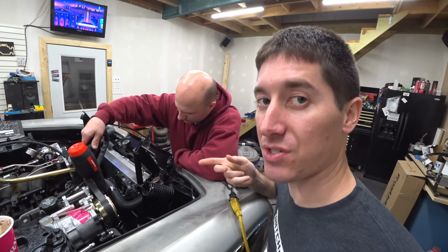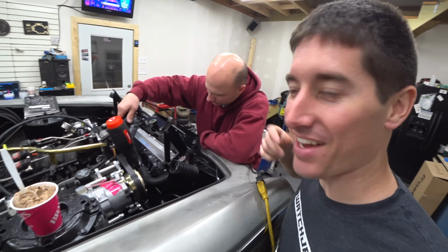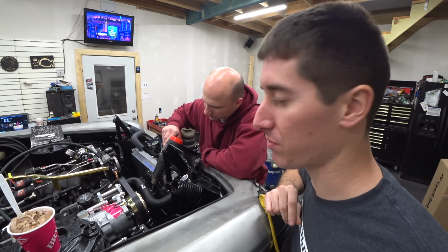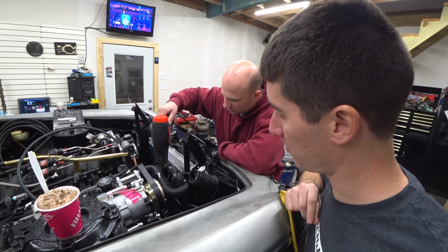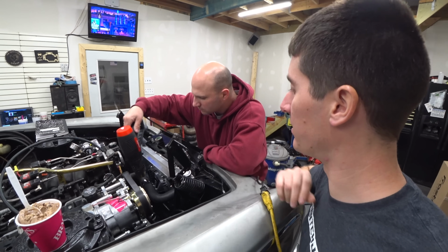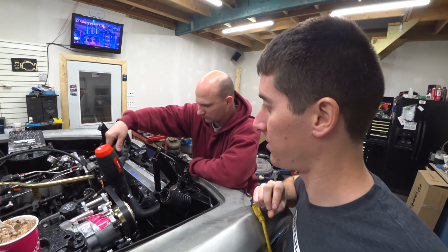And you can actually use these to replace your hose clamps. You can just put them on the end, slide on one of these power grips, and you're good. You can cut them back off. They're $5. It looks better than any worm clamp. You can actually see it start to shrink. Yeah, it sure looks like it's starting to shrink. Starts to contour that. And I think it also continues to shrink when the engine comes up to temp. Anyway, we're gonna finish this up, and we should have really pretty custom radiator hoses.